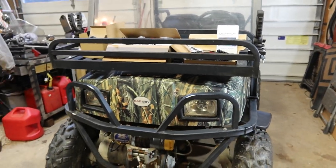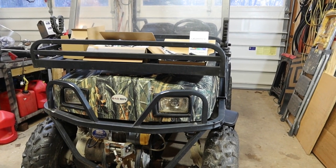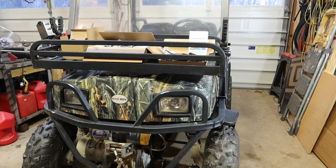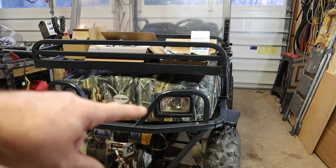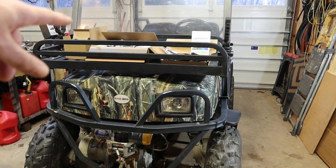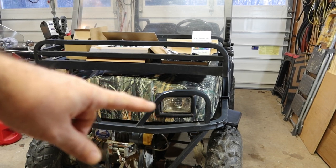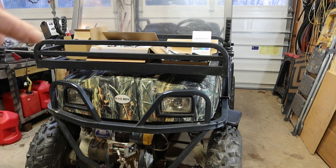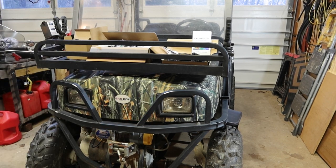So on an electric cart, the life of the battery is your biggest enemy. The faster you draw current, in other words, if the halogen bulbs are hypothetically drawing 10 amps and the other ones are drawing 5 amps, both sitting at 12 volts, then your batteries obviously are going to run down faster with something that's drawing a higher current. So we want to find out what the new pieces are actually drawing current-wise, make some educated guesses, and give this thing some exterior illumination.